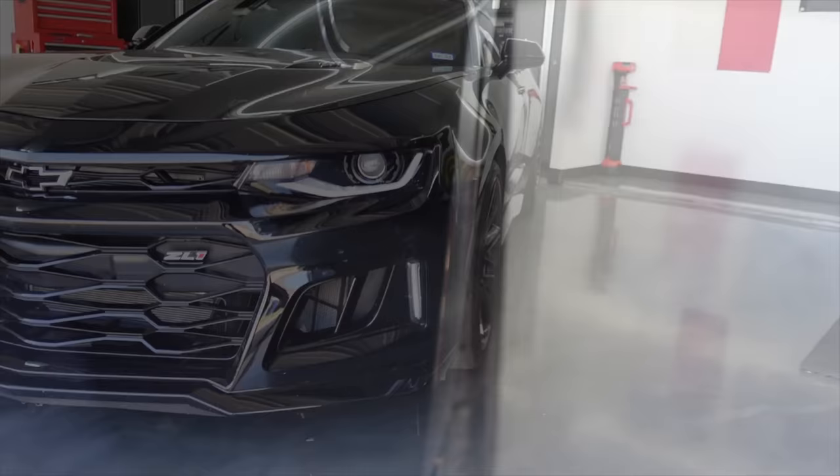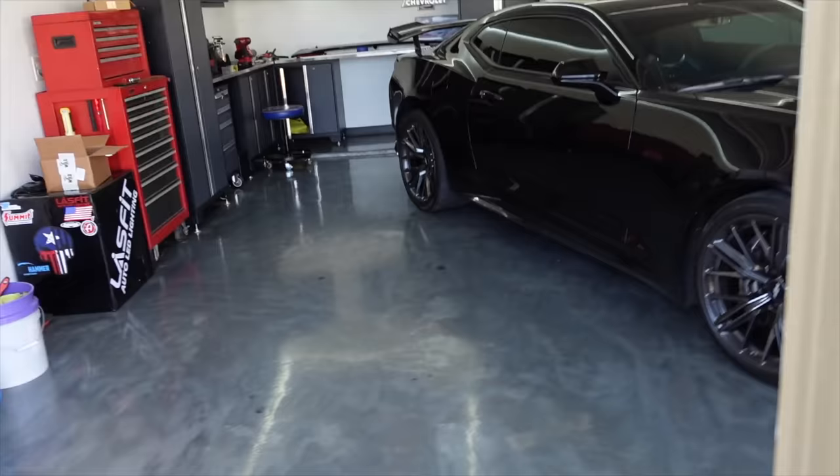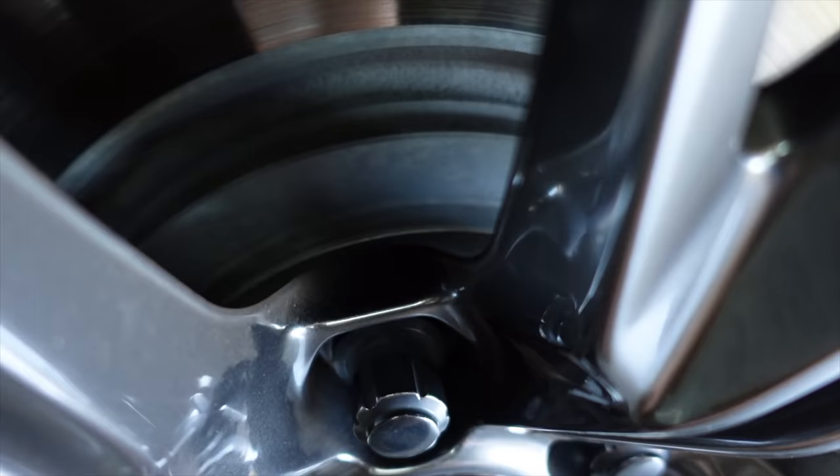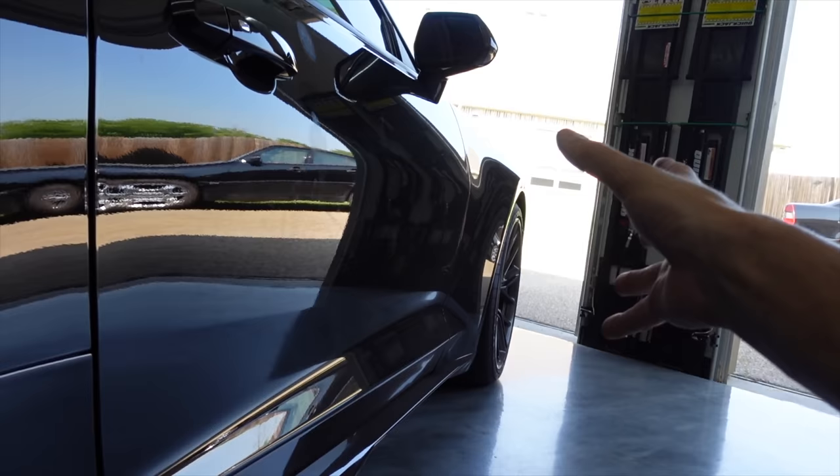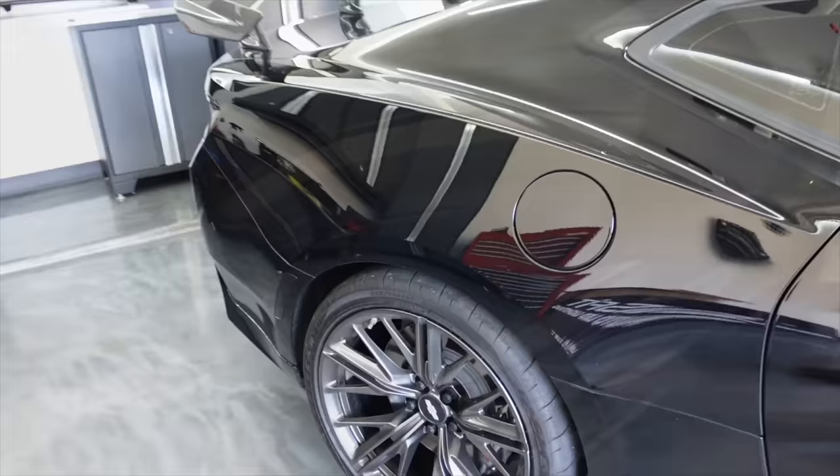I really like where these landed. These spacers are unfortunately not hub-centric, but what's nice is they're thin enough for the wheel to actually bolt onto the hub. So the wheel is still mounted like it was from stock. The actual lug nuts on the front — even though those are five millimeter — you get seven full turns on the lug nut. If you go like a 10mm, you're probably going to have some issues. But five? I think you guys are set.